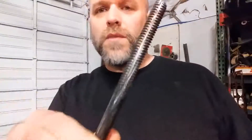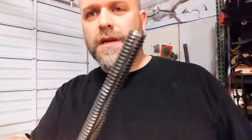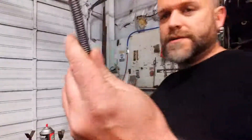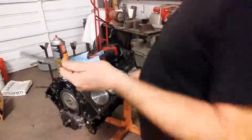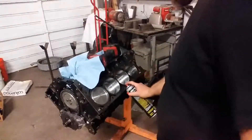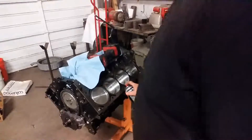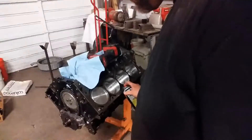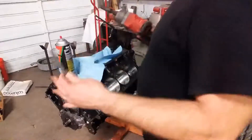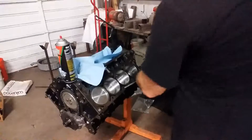So if you are replacing the bolts, you can take an old bolt like this — the old head bolt — and just cut a little groove into it like that. With a little bit of brake cleaner, you just spray it in the hole there, standing off to the side. Run this in there, nothing crazy, don't impact it or anything.